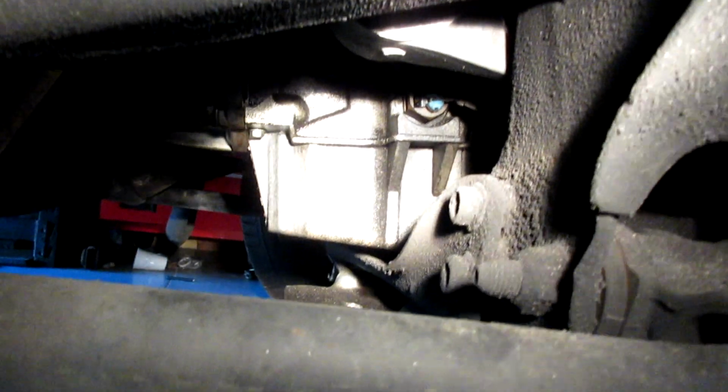Seriously. O2 sensor. Get a good shot at it right there. That should be changed. We got a leak coming from somewhere though. If you see, all on top of the oil pan, it's all wet on the block. I don't know why. All behind there. I don't know what's going on with that. I kinda get a good view over there. Yeah, that's dry up there. Look at that mess over there. Where's it coming from? All on that side mostly. Drips down on the pan. It's not that sensor thing, I don't think. Could be crank sensor. We got the Chinese tech too now.